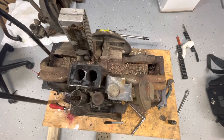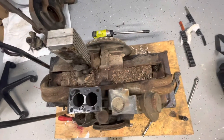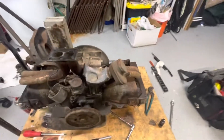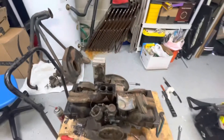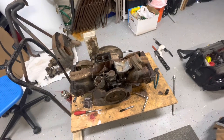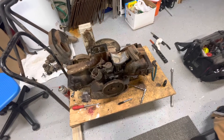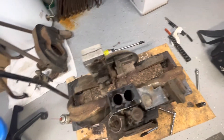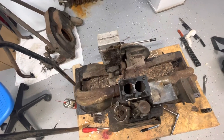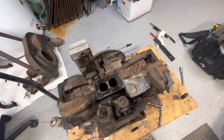I'm working down here because you can see the amount of mess in there - you can see the seeds, the hulls, and it was coming right out of the exhaust. The exhaust is just chocked full on both sides, with stuff coming out of the exhaust pipes. This thing was a home to a rodent of some kind. I don't even know what I'm gonna find - this engine may or may not be salvageable. The case probably is, the heads might be toast. If they made too many mouse nests in there, urea will burn right through those heads - basically the mouse pee will burn right through and pretty much destroy them. So I'm gonna get this intake runner off and see where we go from there.